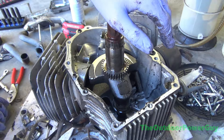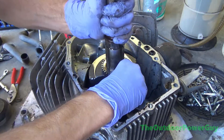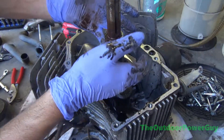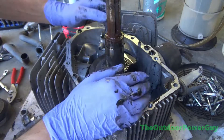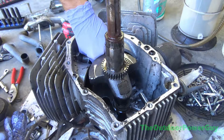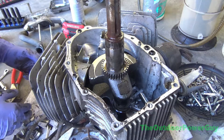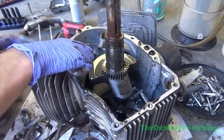It wasn't low on oil — it had oil in it, but it just wasn't enough. I cannot turn this crank; it is seized where it goes through the block. And this oil is just nothing but grit. I'll knock a piston out. There's another piece — it might actually be a cylinder, it's hard to tell. But these things are all rod. They are pretty violent.